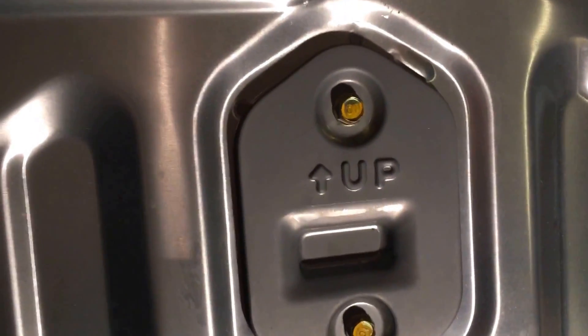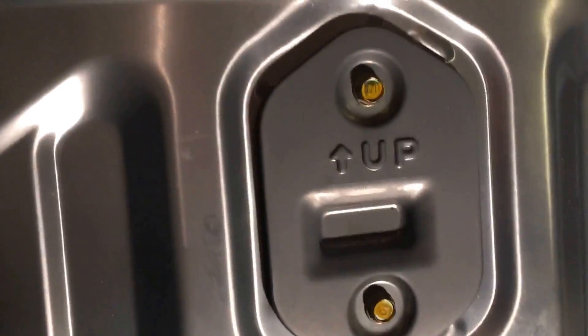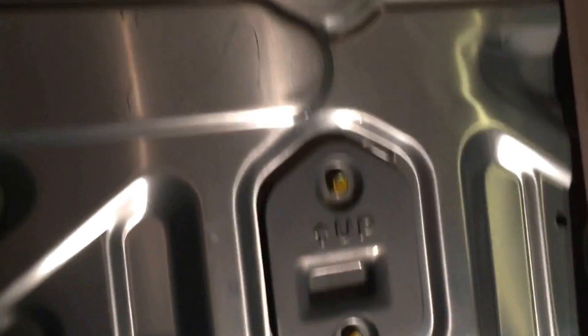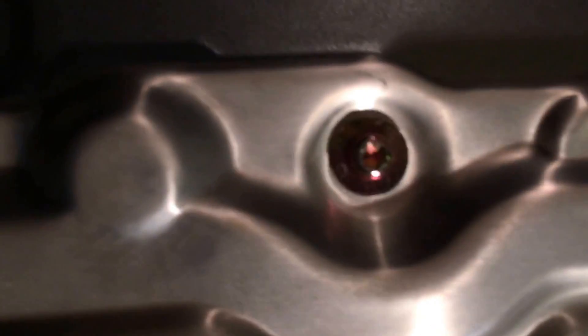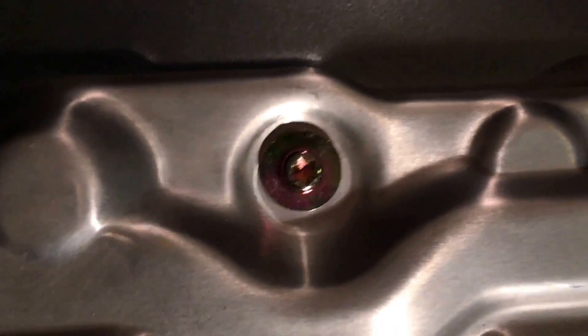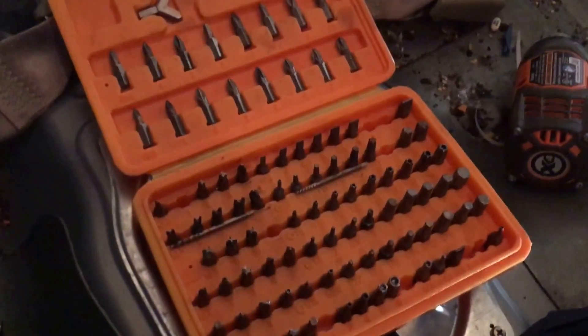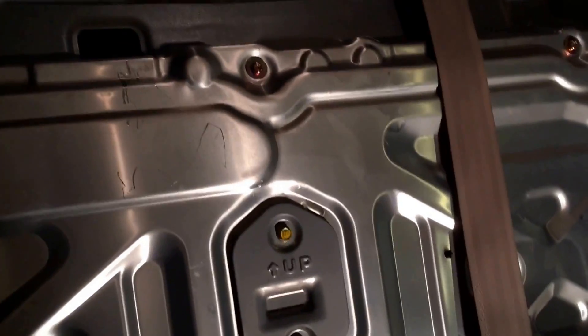Not the first time I've replaced a battery in a hybrid. First of all, you're gonna remove this cover right here, which gives you access to the on/off switch. Then all around the outer edge you're gonna have these special torx head bolts all the way around. A T30 bit will take those off. Keep in mind a T27 will fit in there loosely — a T30 will fit in there nice and tight. So use a T30.